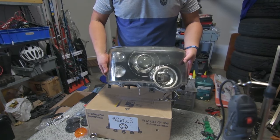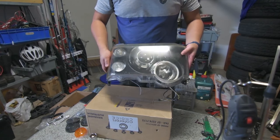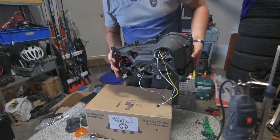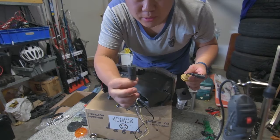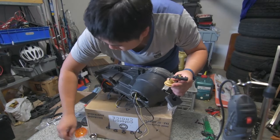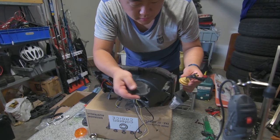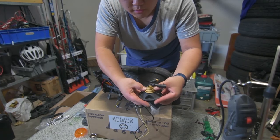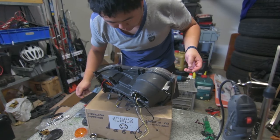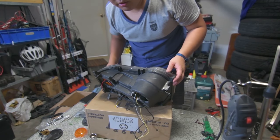There you go — that's how you fit the projector in your D2 headlights. Just finish off your wiring obviously. Use a 22mm hole saw, drill the cap out, and then that will just sit there like that. That's what I'll be doing next, so stay tuned.